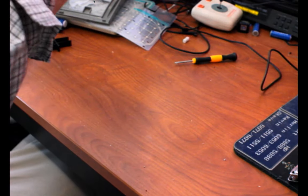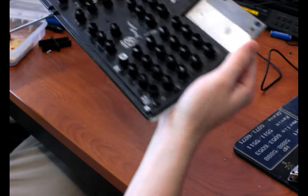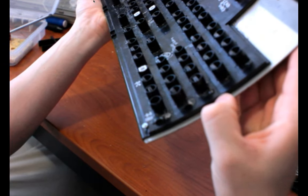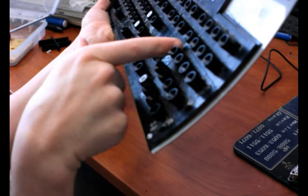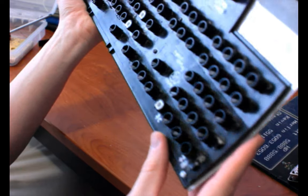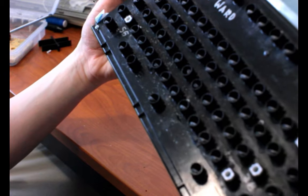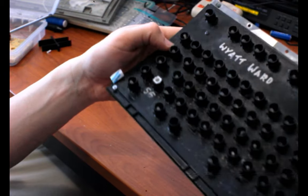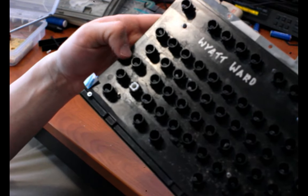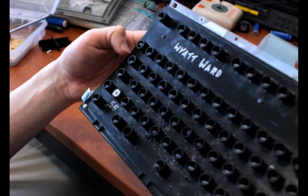All right. So now I have that all apart. You can maybe see the fissure in the plate right there. See that crack? It goes all the way up to here. Yeah, it's a nice big long fissure. And there's a smaller crack on this side, right above my thumbnail. And some of these things, you might see something that looks like a crack here, that's just a fold right now, but they can turn into cracks if you're not careful.